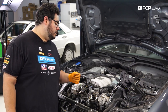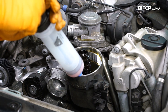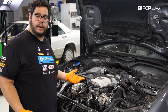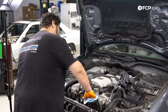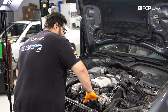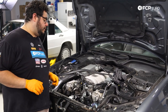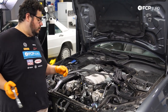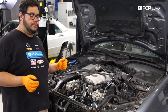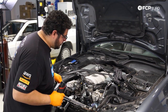Using our syringe tool, I'm going to extract some oil out. As you can see, there wasn't a whole lot in there, but every little bit helps when it comes to keeping our work area clean. I'll give this a little wipe down. Next, we're going to remove our belt tensioner assembly. I recommend you undo the bottom T45 first because you have to un-tension the device to get a tool in there, and then the top one is easily accessible without the tensioning.